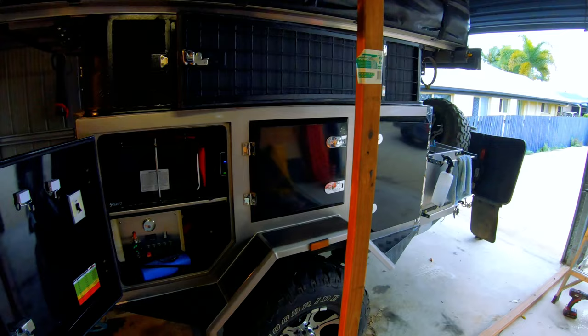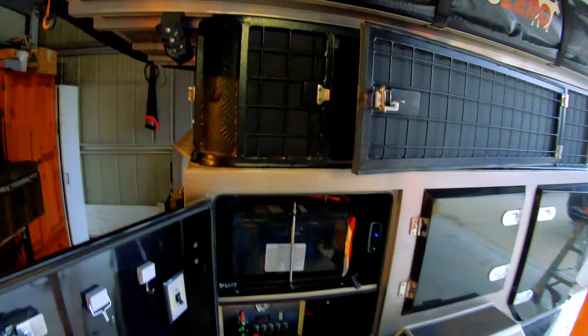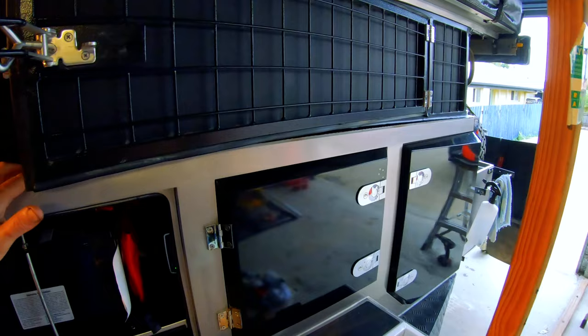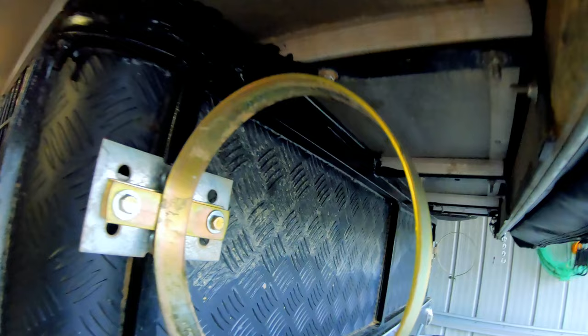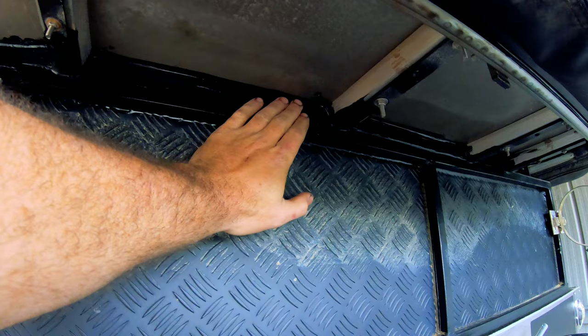It's all in - got a few more things to do to the camper trailer and we should be in good stead. Just going around resealing where I've already sealed before, but the last couple of trips in the rain have shown us that it's not fully sealed. These doors are fine, there's just a couple of spots around this seal where water was coming in and also at the top. I've actually sealed off this hole under the tent area and also in the rails, so when you're driving in the pouring rain no water gets in underneath there - it was pooling underneath the tent.